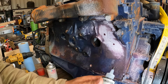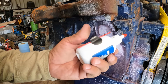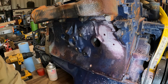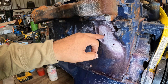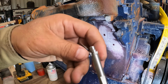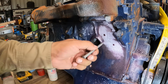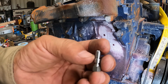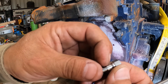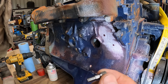And so they give you a drilling, tapping, cutting fluid, and a specific thread locker type fluid as well. And so as you drill the holes and then tap it, do a little recess. This here creates the recess that is mimicking this section right here. You will recess it in there a little bit, put the thread compound, tighten it. This will snap off. Portion of this will stick up above the surface of this material. Then you sand that down, and then you can clean that up or prepare it for paint.